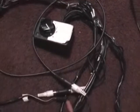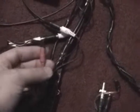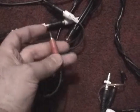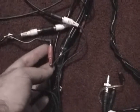This setup originally did not have sound running with it, but you can pick up a microphone. Just like the cameras, it is a powered microphone, so you'll have to run 12 volts to it too. They all have either RCA style plugs like this one or something similar, so it's pretty easy to integrate in. I do have a single microphone instead of 2. The camcorder I'm running does record in stereo, but because I only have 1 microphone, I run a splitter, a 2-into-1, and so I get the same sound on both channels. Microphones are about $15, so one of these days I'm going to upgrade to that.